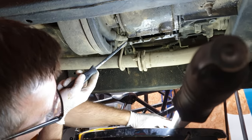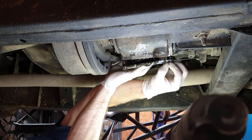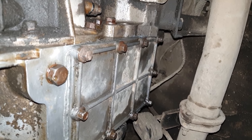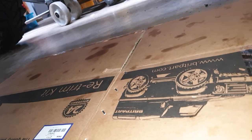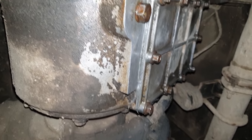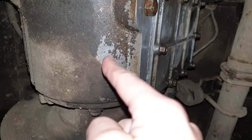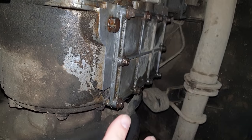The transfer case is leaking oil and we think it might just be leaking out of the seal, so we're resealing it — hopefully it's going to stop leaking. Ian's got the plate back on the gearbox transfer box and nothing's leaked yet. But someone else looked at it and suspects there's an input shaft further up where it's leaking from, so hopefully that's not the case, otherwise it's going to need a full transfer box rebuild. The chassis on this looks in really good condition.